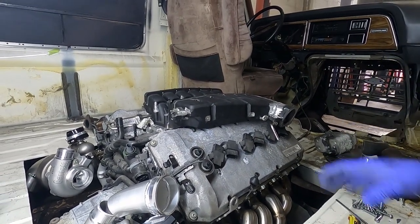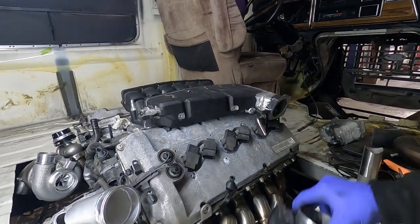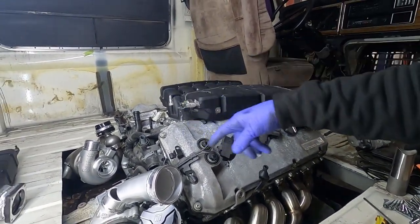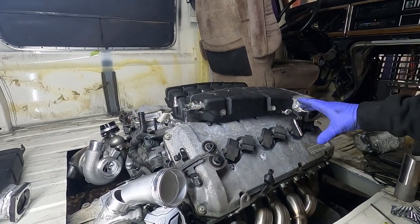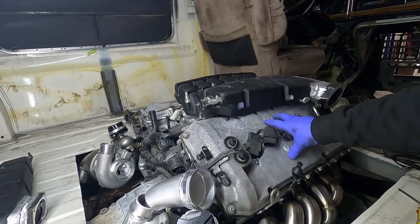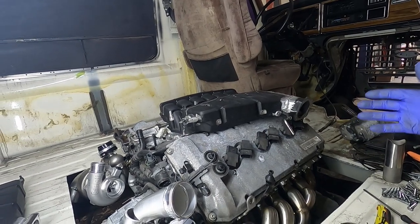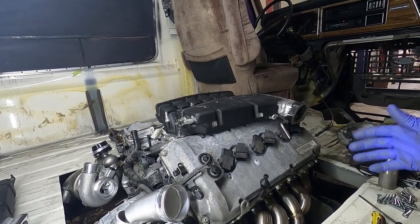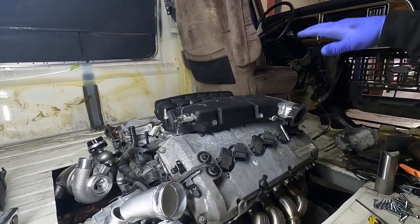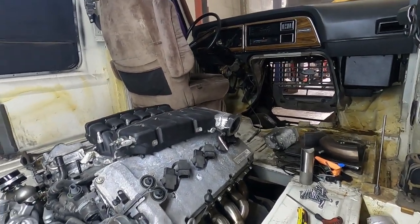You want it to look good and you want to have the air filters here - if I put the throttle body here, the boost pipe is going to be here, so you've got this rectangular section just for the air filter. It's a perfect position visually, though not perfect for heat since the engine generates heat and you want as cold air to the turbos as possible. It's a compromise, but it's not a big one because there's plenty of ventilation - we don't have a bonnet fully closed, it's very ventilated, so it should be good enough.